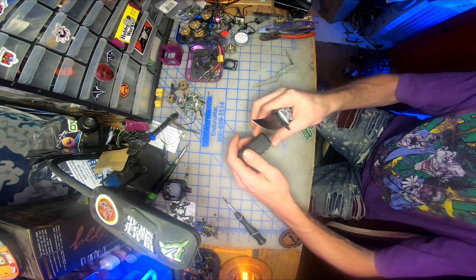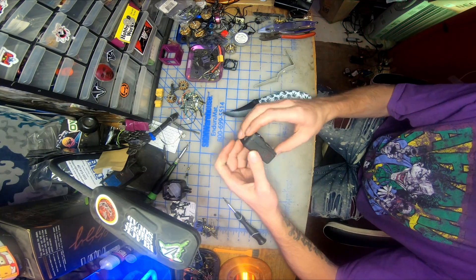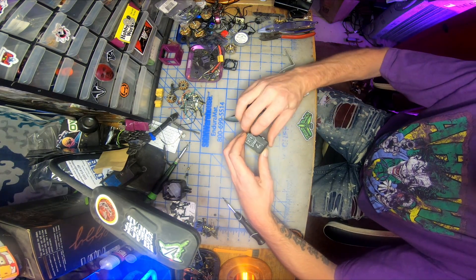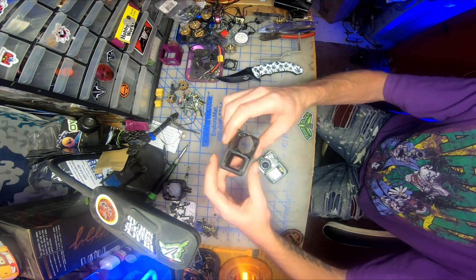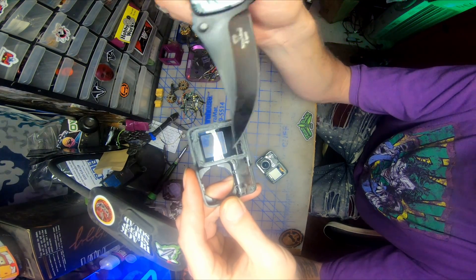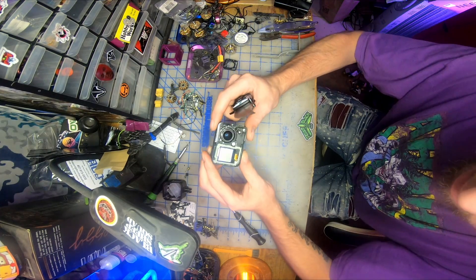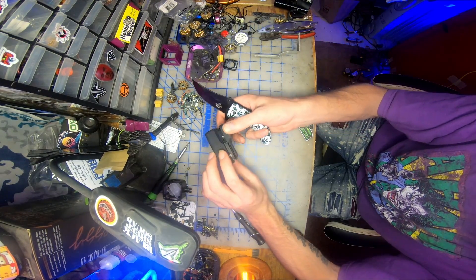Now I want to try to be really careful with it, because I want to put it back together pretty clean without destroying the case. That's the goal — be as clean as you can. Because if you destroy the case, it's kind of screwed. I plan on fixing the 7 back to how it is. Once you get the plate off, you can see the glue. That's where I was heating around the screen. Try to stay away from the lens area, heat around the screen. That's why I like to use the knife — it kind of helps get into the edge, but be careful because it can cut you. Looking at the camera, it's pretty clean, very little glue residue. The case is probably reusable, I could seal this back up.